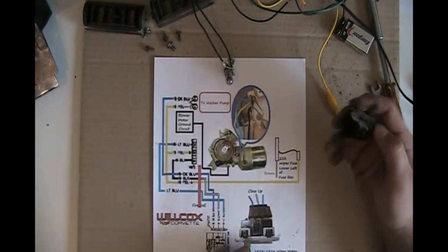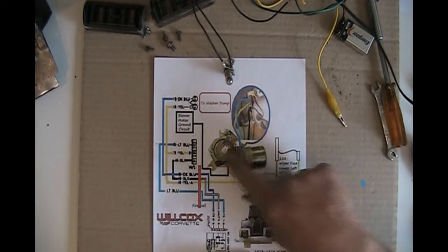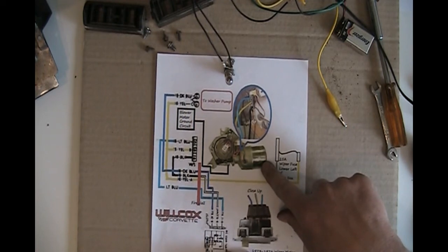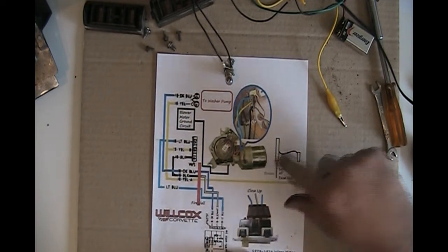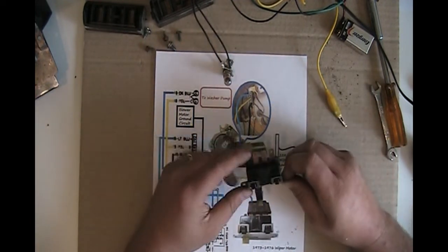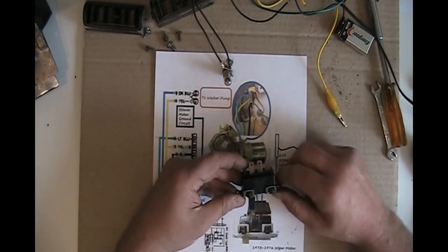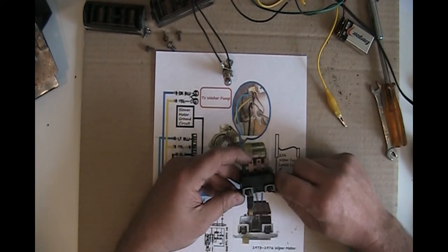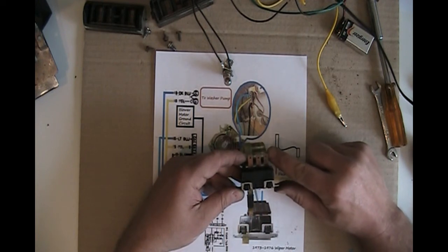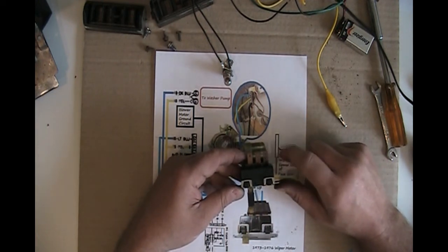In our next video, or a future video, we'll look at the windshield wiper motor and make sure that operates correctly before we install it in the car. Alright, so this is your switch, and that's your motor. Basically, your ground is your center. To operate the windshield wiper fluid is here, and then to operate the windshield wipers themselves, the motor is here.